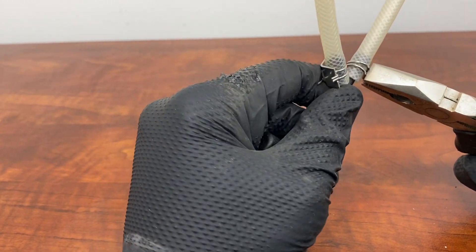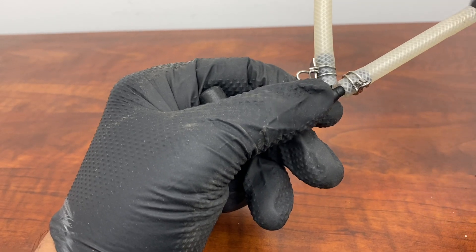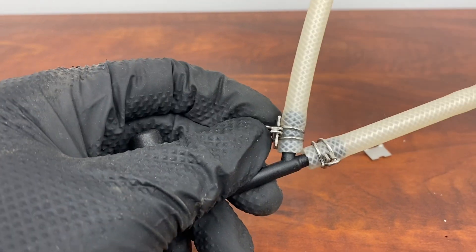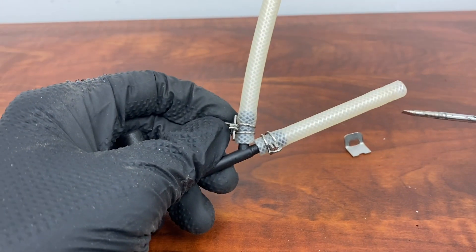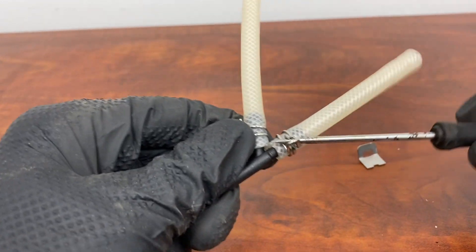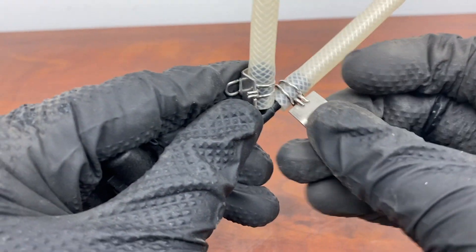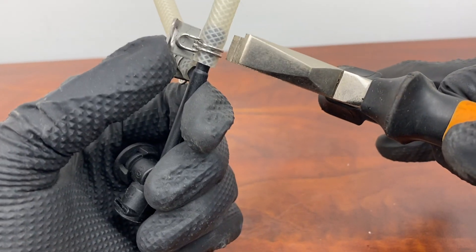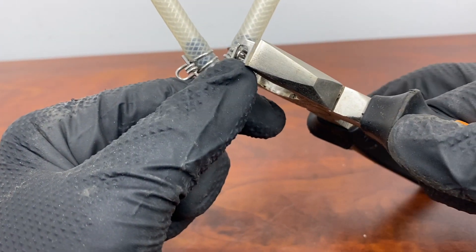Position the clamp at the right spot. The clamp is back on, and now I need to put the lock on so that it's locked in and tight. The clamp itself has tightened, so use a flathead screwdriver to expand the clamp just a little so you can slide the lock back in between. Then grab your plier, put one end to the back of the hose and the other to the front lock, and just press.